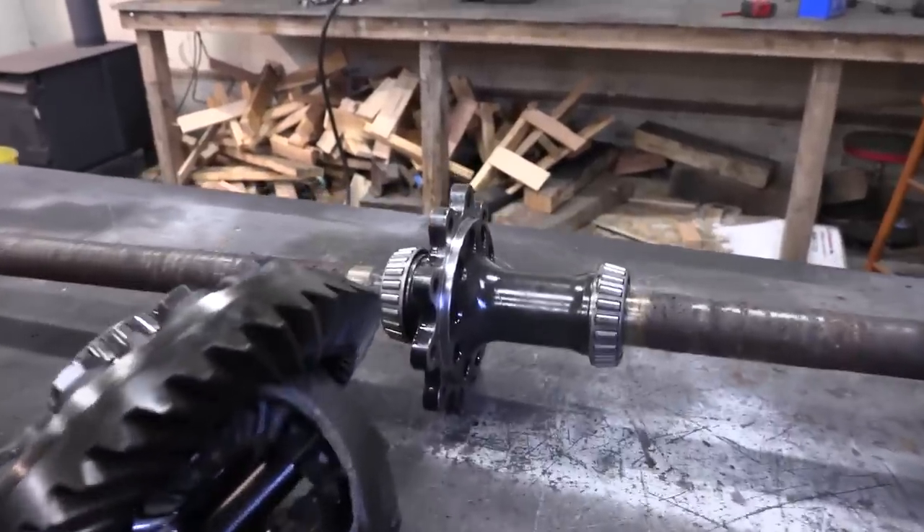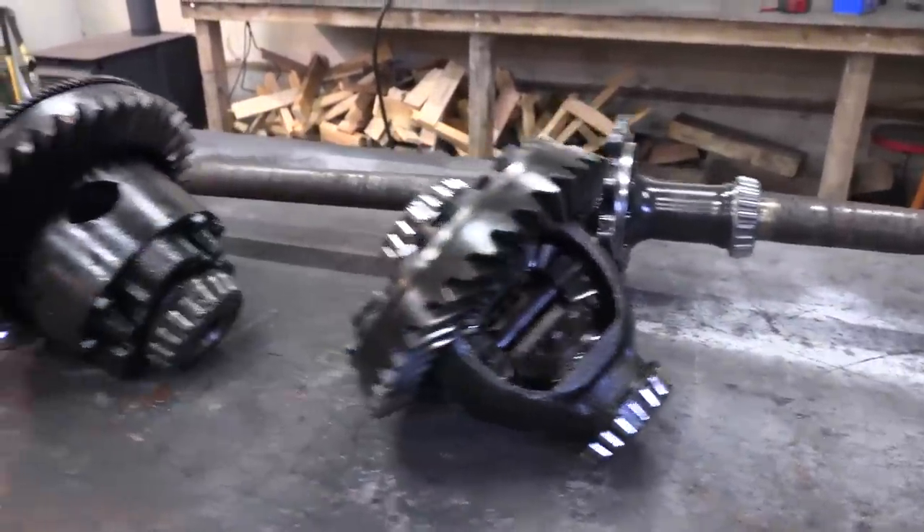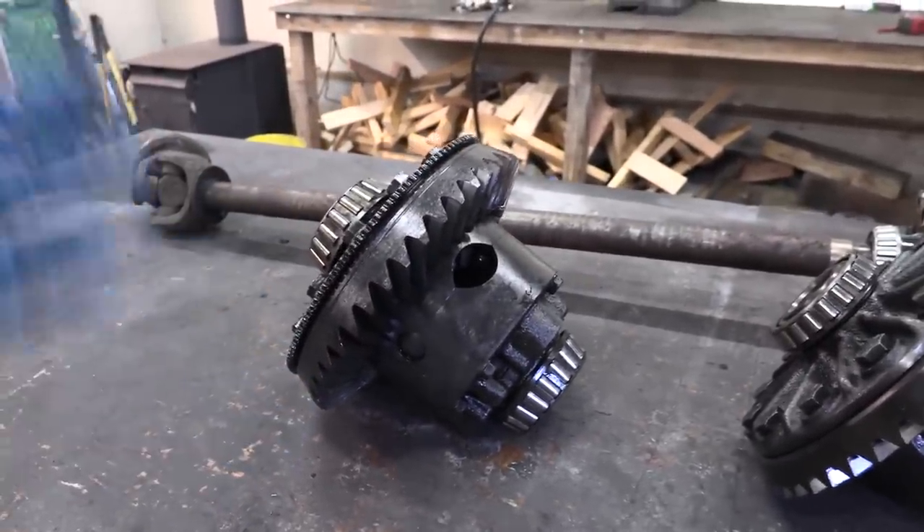You can get one tire up in the air, and if your tires are big enough, they will overwhelm a limited slip no problem — then it will act much more like an open carrier off-road. But if you're not in an extreme situation or you don't have extremely big tires, these work pretty well. The clutch-pack style limited slip is great up to about a 31 in my opinion. Once you get to a 33, it's still really good off-road, but in rocks or extreme terrain you'll notice that if one tire is pinned between two big rocks, one will spin and the other will stay locked in just like it's an open differential. Tire size has a lot to do with that because of leverage. As long as you stay to a 31 or smaller and use the right lubrication and keep your clutch packs healthy, these are going to work awesome.